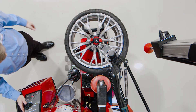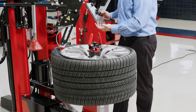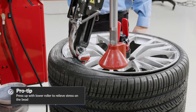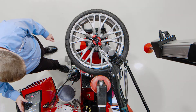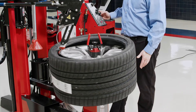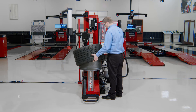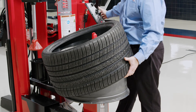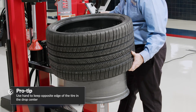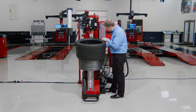The third thing I like to do, especially on really tight tires, is to bring my lower roller up and bump up against the tire with the lower roller. You can really see it start to relieve the stress on the bead. I'll just rotate slow to start it out, then go ahead and go fast. For the bottom bead, I'll use my roller the same way — keeping the opposite edge of the tire in the drop center and using the roller to push that bead up and off.